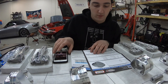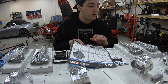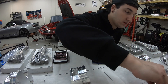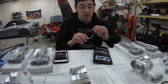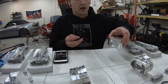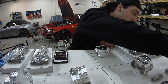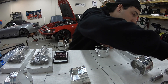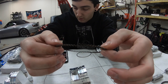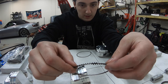Alright, so we're going to start doing the rings. Your pistons and everything will come with spec sheets showing how the rings should sit. If there is writing on the rings — which these ones do have — the writing goes up. I already gapped the rings: the top ring and the second ring. The oil ring you don't have to gap. So I'm just going to start putting rings on. With the middle oil ring, you don't want them overlapping — you want them just butted up against each other.